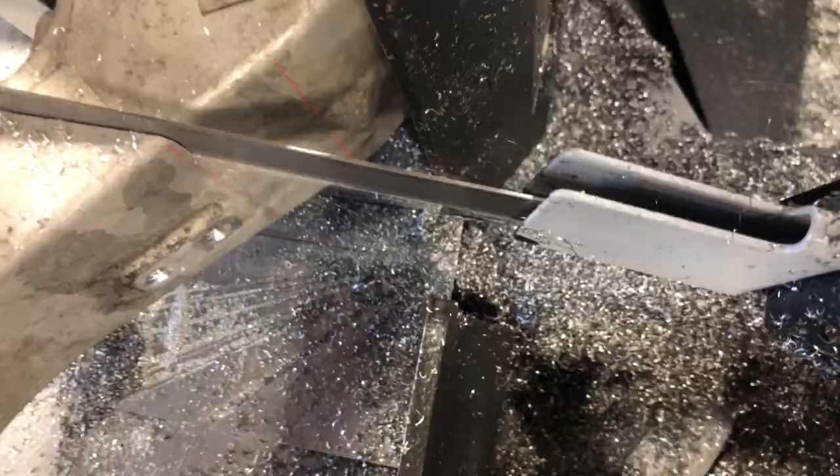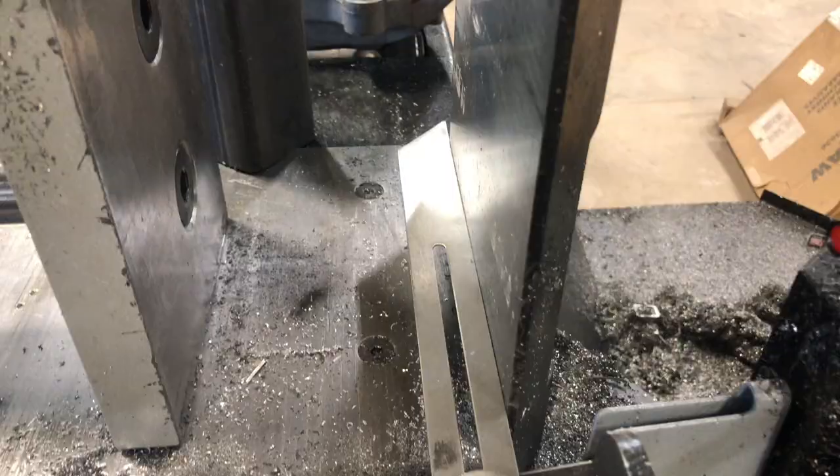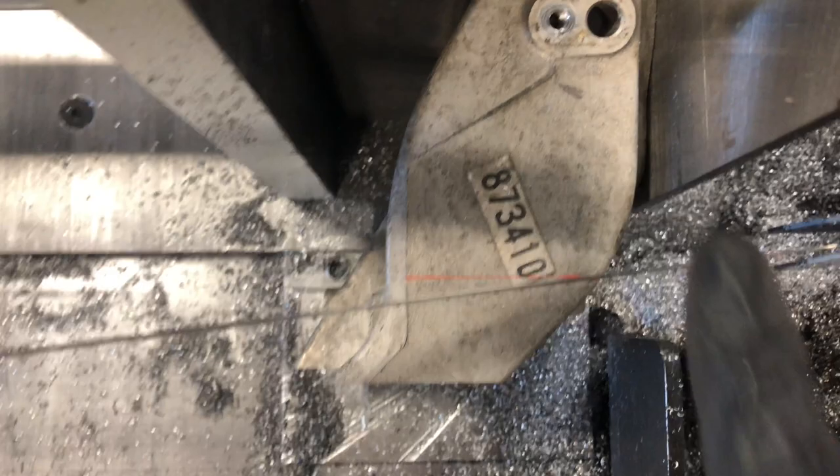You've got to lay it out where you want to cut it. I got that piece cut. Next up I'm going to be adjusting the bevel of this to seven degrees, because that's the tilt that we want out of it. I got this bevel square set to seven degrees and I'll get that set. It's inch and a quarter shortened, but because it's at an angle I'm lining it up with the front, so it'll be an inch and a quarter shortened up front and tilted to seven degrees.